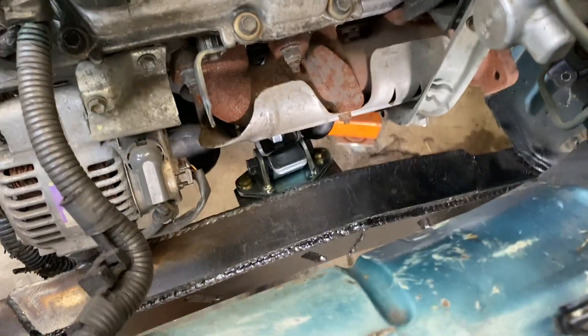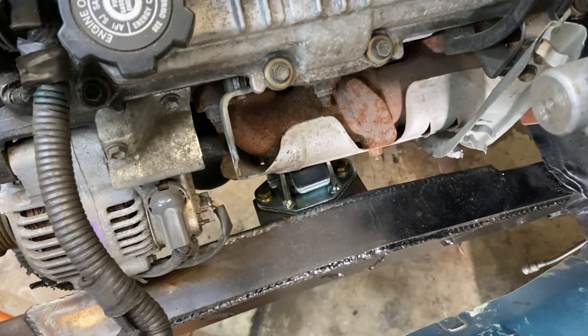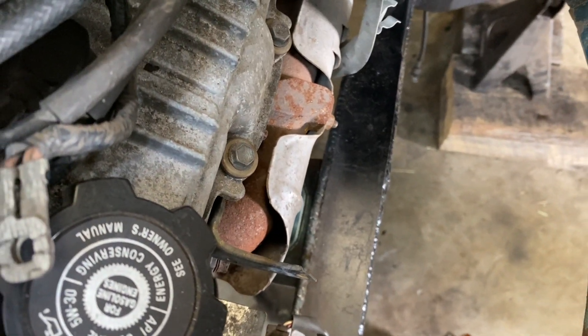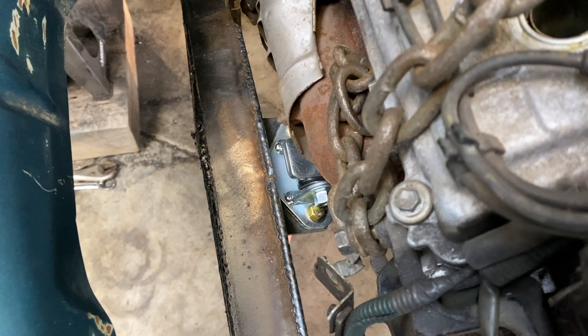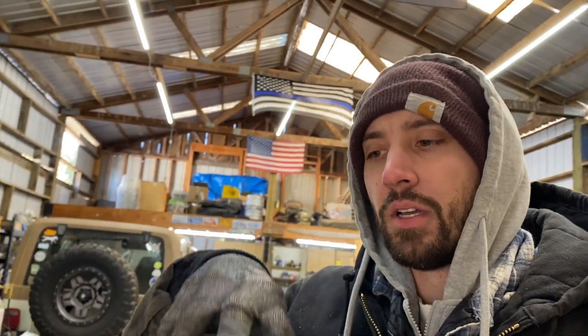I got the bomb-proof mounts bolted in. I have just a little plate — I think I cut like a three-inch by five-inch quarter-inch plate — and I do have the motor shifted over to the driver's side. The bracket is about a half inch off the inside frame rail, touching but not welded yet. I cut three different little gusset pieces per side — one in the middle and two on the sides — so I'll have like three little prongs. I'll have to unbolt the motor, bring it up a little bit, get a weld on the top, and bolt it down for good. I don't plan on taking this out again.